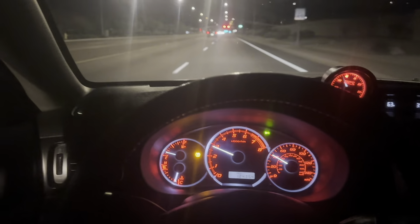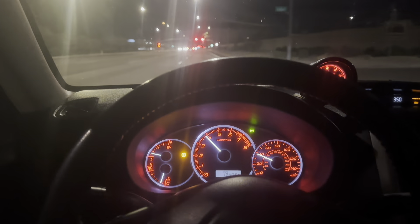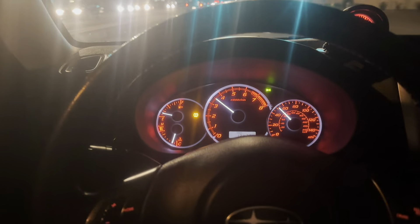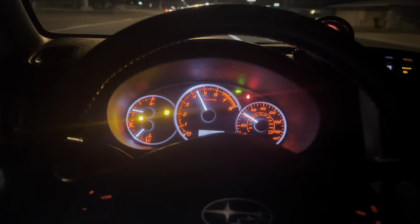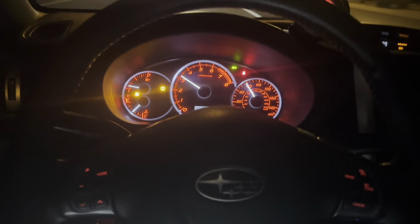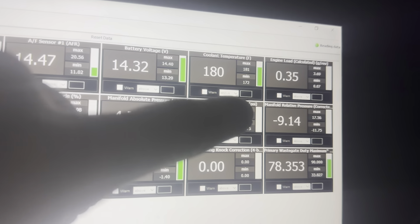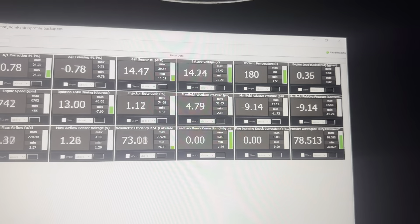Couple little driving videos just for the sound quality - sounds nice, a little downshift, a little bit of boost. She sounds good and healthy. Do a nice little second gear here - she's a ripper! We're using 50 to 54 percent of the injectors at 17 to 17.5 pounds of boost. AFRs are just gorgeous at idle. She's making some good power. If you enjoyed this video please like and subscribe - thank you for watching, just bolt-ons and tuning.